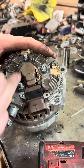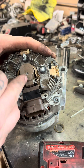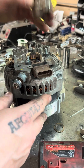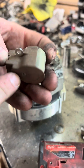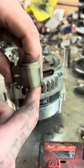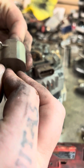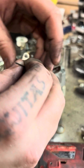You're gonna have a brush holder in the center and your regulator screws — on our alternators they're all T20s, though some may have Phillips depending on the brand. Pull the brush holder out. You can take a paper clip; you'll see a hole here and a hole here. Slide your pin through the hole — that'll let you put the brush holder back in without damaging the brushes. Pretty important step.